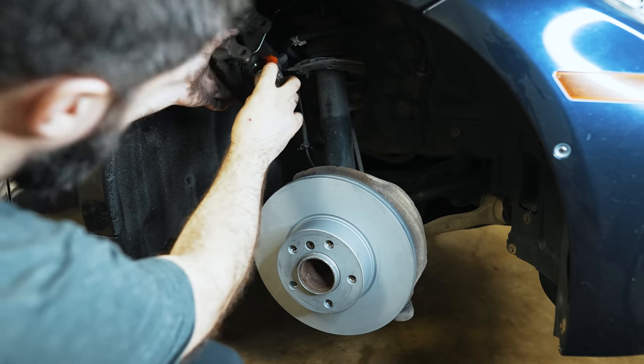So I got this wheel put back on. Since I'm not ready to lower the car to ground level yet, you can use a torque stick with your impact gun to set the torque — this is a 100 foot-pound torque stick. That'll conclude this video showing you how to replace your brakes on a BMW. It's pretty much the same process for any BMW in the last 20 years. I debated putting this up but I'm going to be away for two or three weeks so I wanted to keep the videos flowing. If you got some value out of this, please consider subscribing and give it a like — it'll help it rank higher. Thanks for watching.